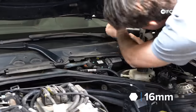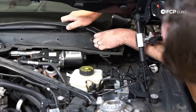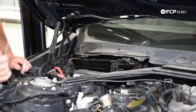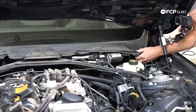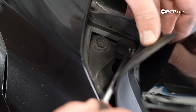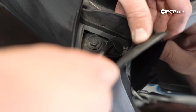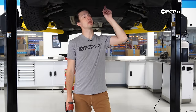We're going to pull up the wipers and pull this rear section of the cowl out. Taking a five millimeter wrench we're going to turn these 90 degrees to release. Right under this side cowl you won't be able to see it, but there is a little release tab that we need to pop up.